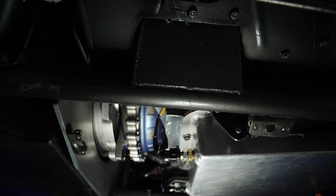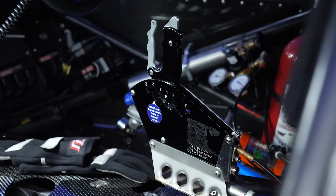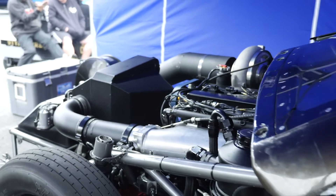It's a little more complicated when we're talking about dual clutch transmissions or modern automatic transmissions, where the interaction between the transmission control module and the engine control module is essential. So can you talk us through the process of how you actually get started developing a solution for these cars? You really need to get a good CAN bus scanner so you can have a look at the CAN bus, then work out what channels are what — when they change, how they change, the pattern they change in. You also need to figure out whether the original program has done it on a full byte or a half byte, or over two bytes, and work out what signals the ECU is generating and how that interacts with every other module in the car.